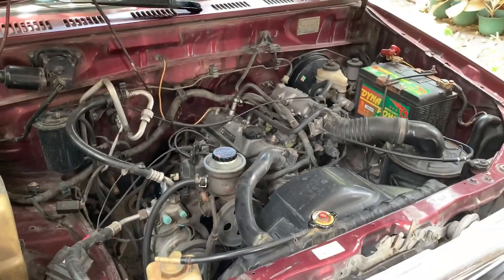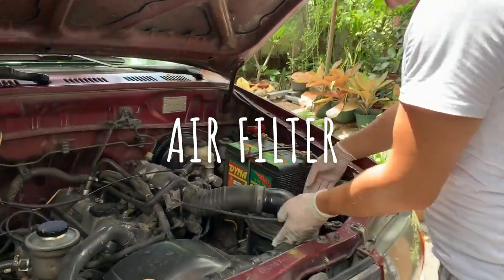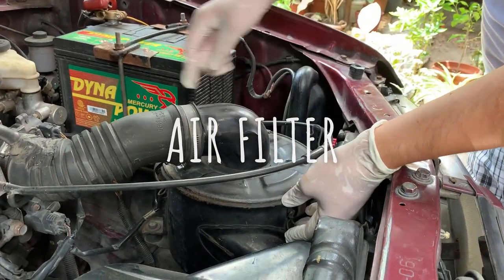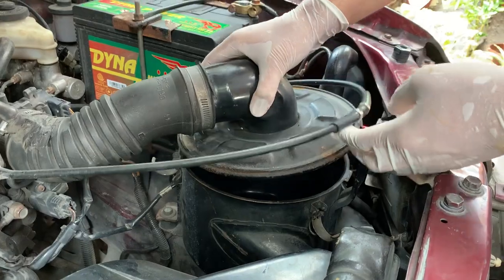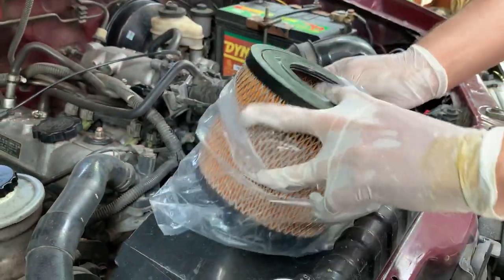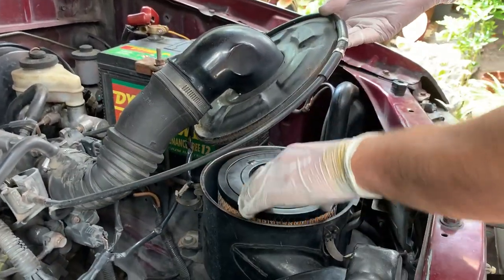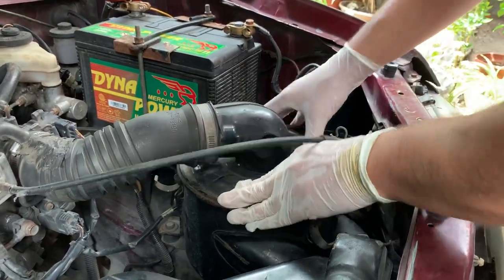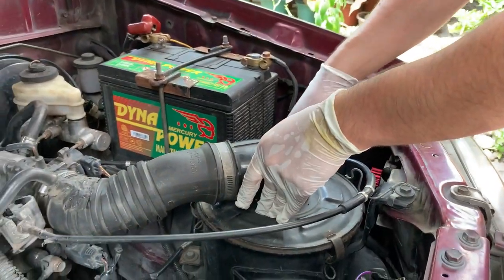So that's the overview — let's get started. We're going to do the air filter now. The air filter is housed in here. Reeve is assisting me today, my nephew. We're just going to take these clips off — one, two on that side, and three. This lifts up. I've actually already removed the air filter, which reveals this cavity underneath. We've got our new air filter — this simply goes in, snug down like that. We replace the cap — it's a nice snug fit — and then clip, clip, and clip. That's our air filter done.